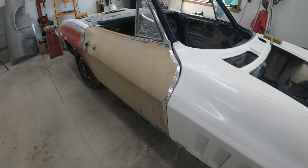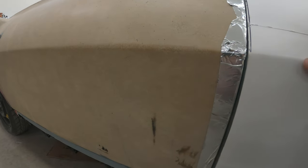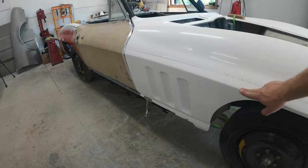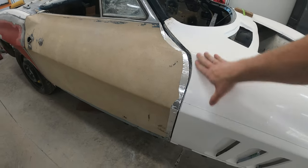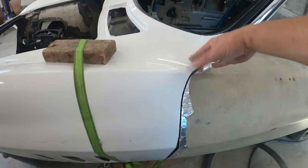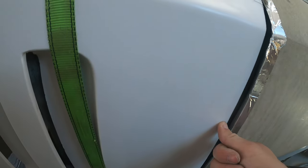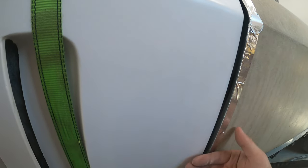I have both the passenger and driver's side hinge pillars bonded in and I'm doing the final test fit on the front end before we go ahead and glue it. I'm really happy with the fit up here — it's a little tight here but we can open those up later. The main thing I'm looking at is the body line, focusing from the quarter panel to about here — it should be pretty straight and then start to dive towards the front, which this side is doing, looking good. The issue on the passenger side is there's a bit of a gap between the front end and the door, so I'll need to build up the flange on the hinge pillar by adding bonding adhesive to that flange.